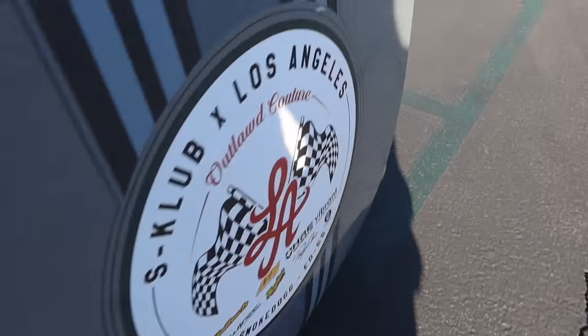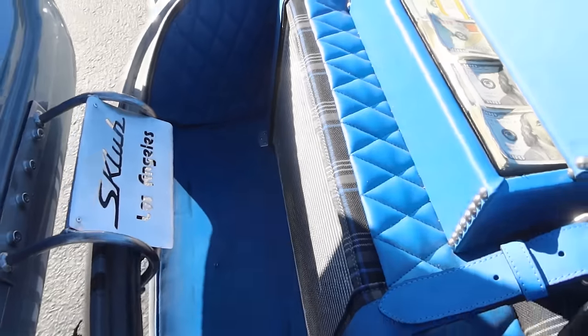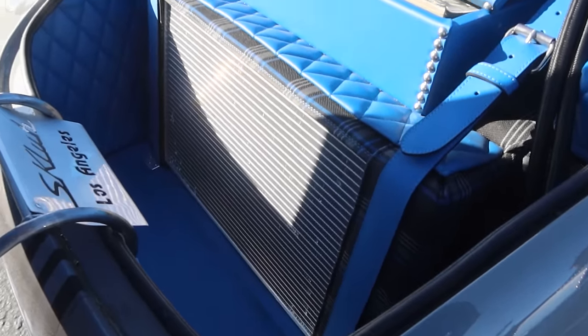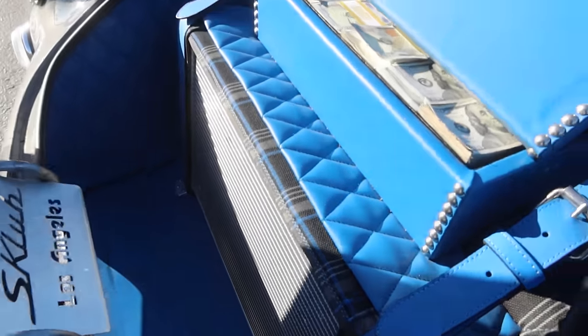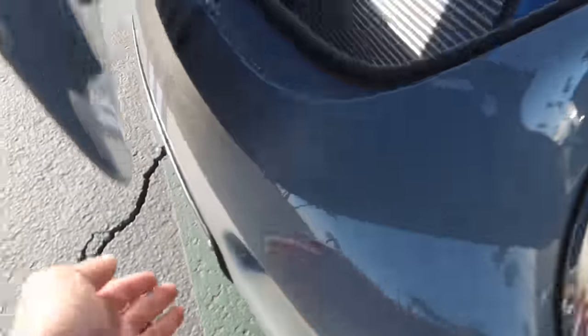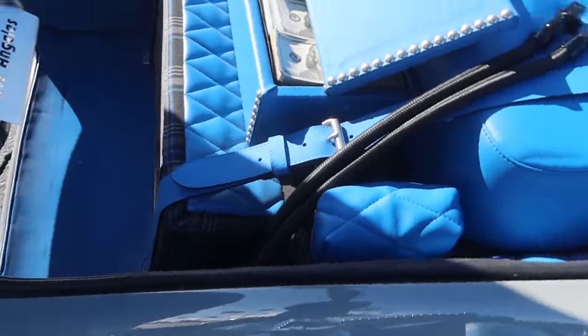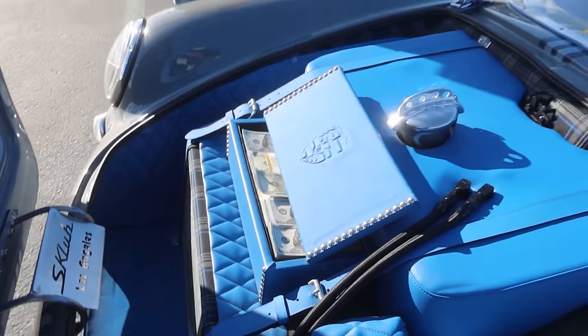One of the things I really like about this build is how finished this is. The radiator, right? Correct. It's crazy to me how finished all of this is. Like the fact that you have tartan covering it is so cool. So the air goes in from here. Yeah, we cut a hole in the front. And it cools it. There's more water in it than a normal Subaru just because of the lines. About 30 feet of line in it, so about double the capacity of the fluids.